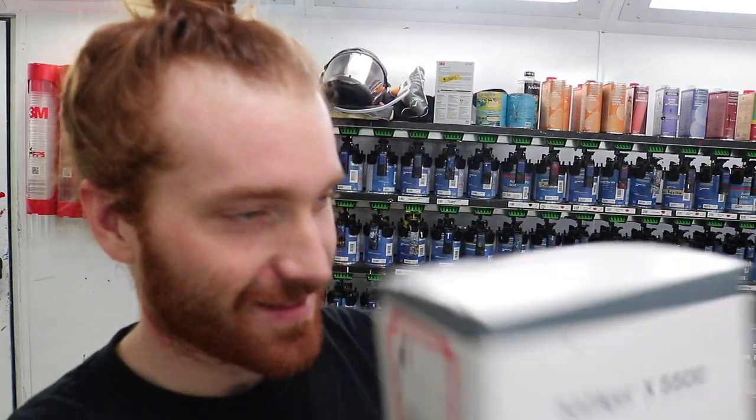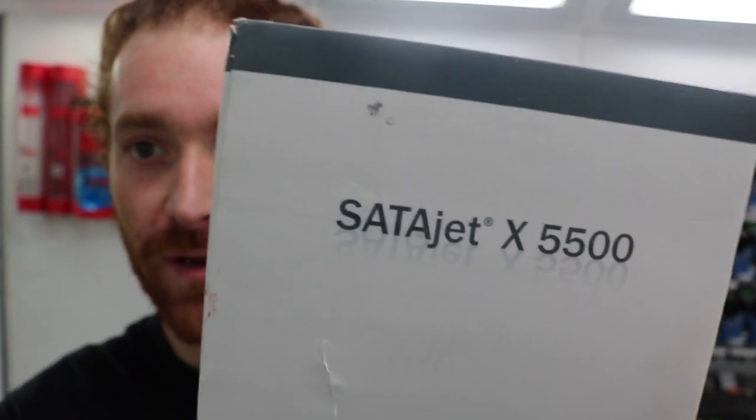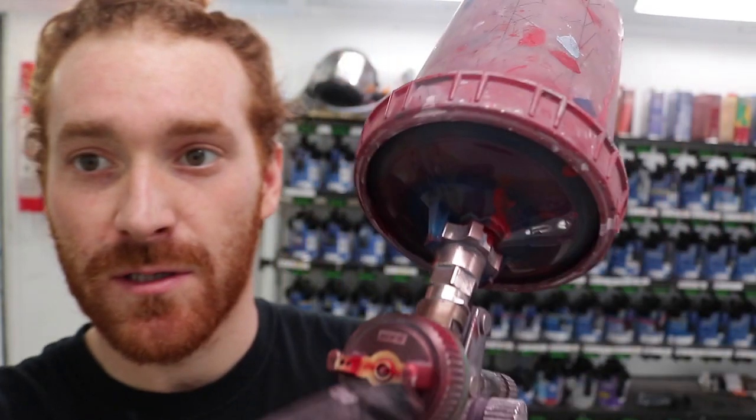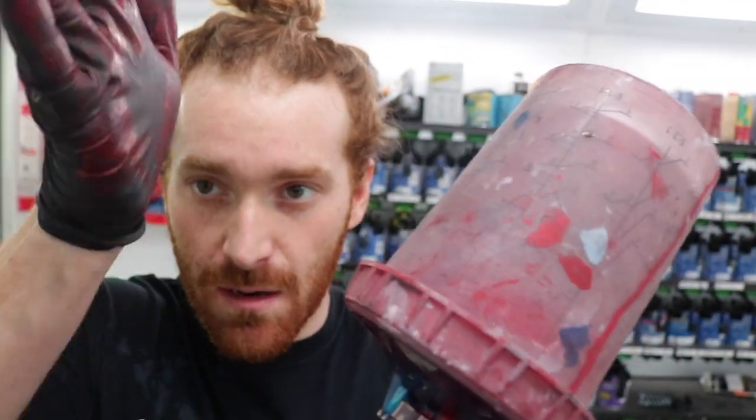So what I'm using on this, I'm using the SATA 5500, let's see. I'll give you this shot because it's clean and mine's dirty. There it is, it's bronze, like a matte finish. SATA 5500. So this gun has two pattern options with the cap. So the cap can spray it like a football where it's an oval, or it can spray it like a more straight line. So I get the one that's more definitive of a straight line,